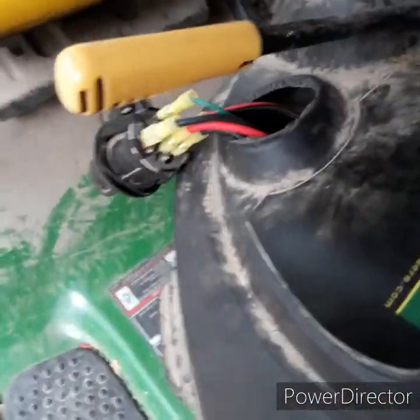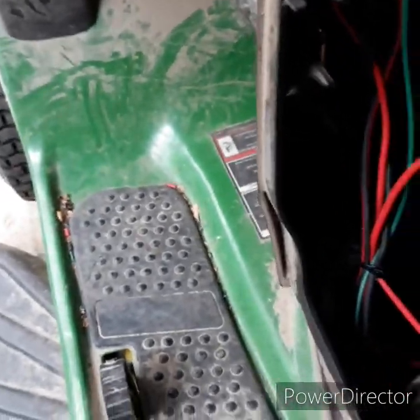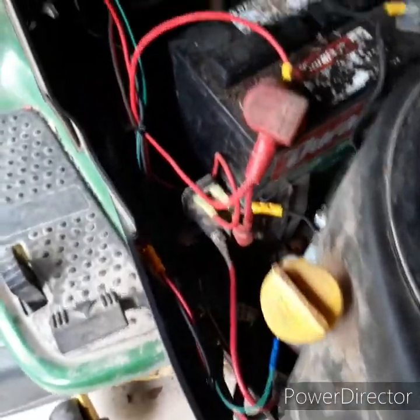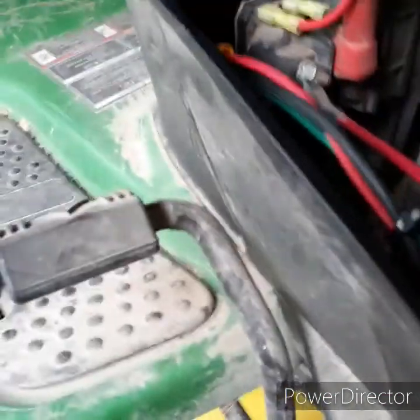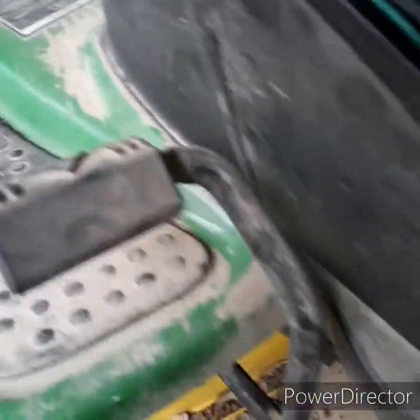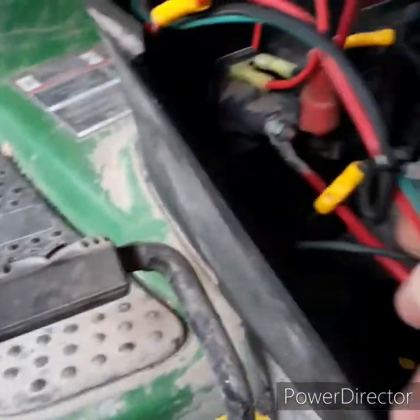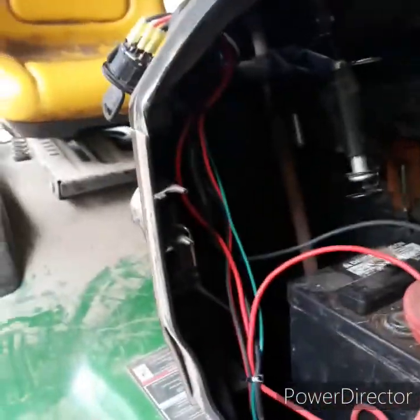The L is where I started to have problems. I couldn't figure out how to get spark. Well, I was getting spark, I just wasn't getting any fuel. What I simply didn't realize was down here we have 3 wires that are coming out from under the cowling. The black wire is the magneto ground, and that goes to the M on the switch.